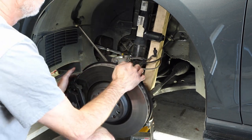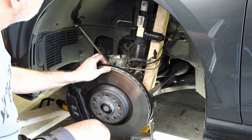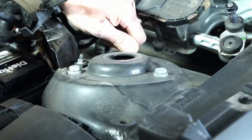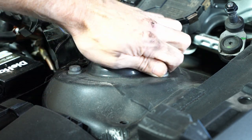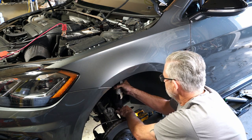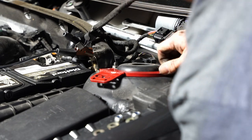That was pretty easy. Anyway, now I can remove that jack and the piece of wood — I no longer need those up there. I'll go ahead and show you taking off the strut, and then we'll put it back on also using the quote-unquote 2x4 method. So I'm just loosening up these bolts on the top of the strut housing, and then making sure I hold on to the strut as I remove that final one so I don't drop it. There we go. I'll do a different video on the camber plates — the Ground Control camber plates I'm installing — that will go into more detail like how to get to this area up here and remove the windshield wiper.